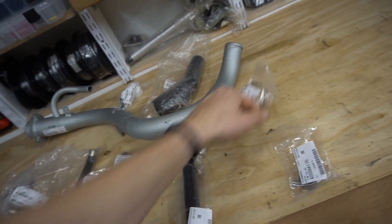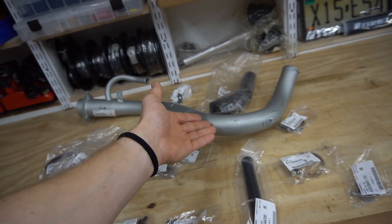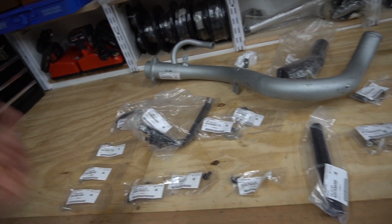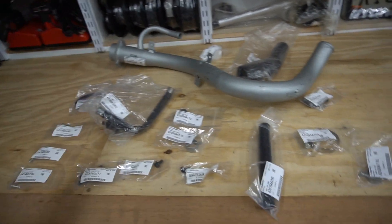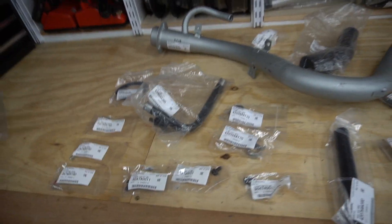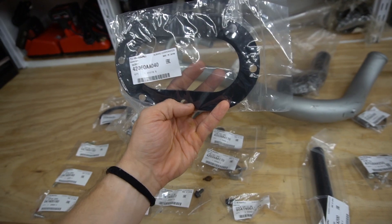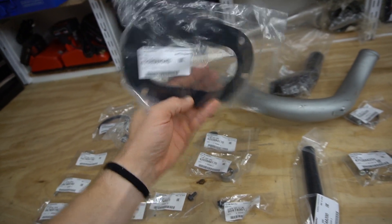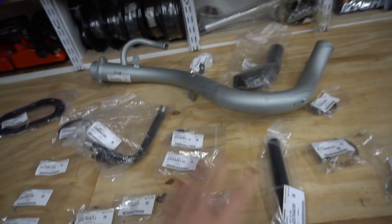All of this came as a kit from ICP and I'm shocked they had it because this is discontinued. A bunch of these other parts are just kind of annoying to source, but they had a kit with everything you needed to replace everything from the fuel tank back. Also, while I'm in there, I'm pretty sure when I fill the gas up I do smell quite a bit of gas when I first pump it, so I got a new gasket for the hanger. It's a 31-year-old car — while you're there, might as well replace it. So that's everything we need.